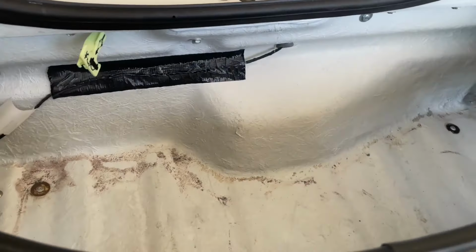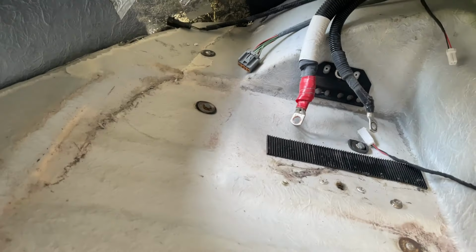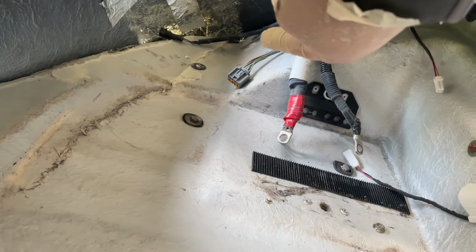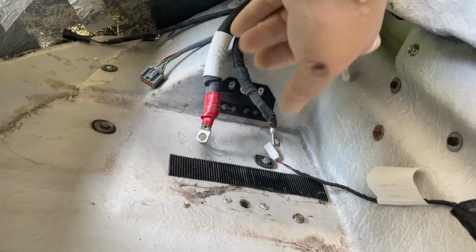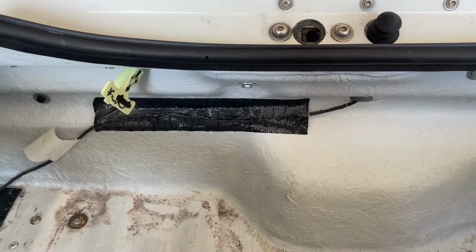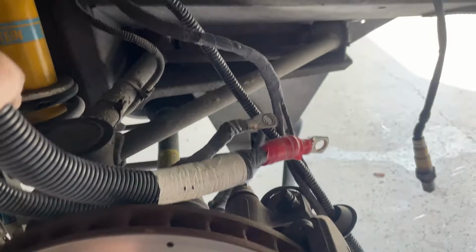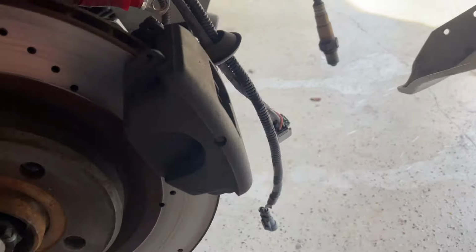Now that the wheel liners are off, the next step would be to remove your carpet, padding, and battery, which I've already done. After that, we gotta start to push those wiring harnesses out through the grommet holes. So that this one as well, push all this stuff out through the grommet holes so it's not snagging when we pull off the clam. All right, so the electrical cables are out. Just for reference, those 2 holes there where you pull like the battery cables and things through. You got the big loom here and the smaller loom here for the lights.